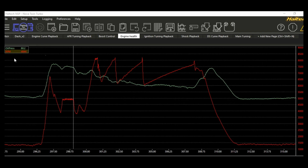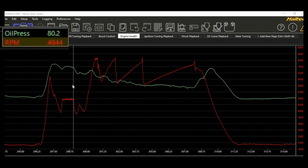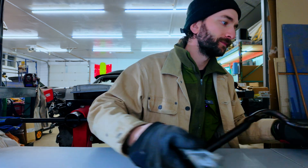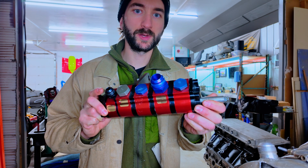This correlates with real-world engine data that I recorded during high rpm racetrack testing, where the engine oil pressure predictably drops off above 6000 rpm and struggles to recover as long as engine speed remains high, often dropping to dangerously low levels under the highest load operating conditions. So I'm designing something better. This is the heart of the system — a five-stage gear-style dry sump oil pump.